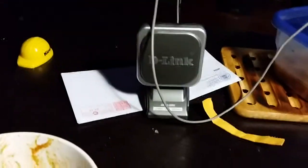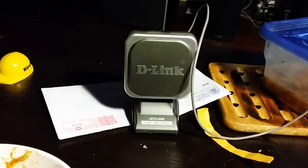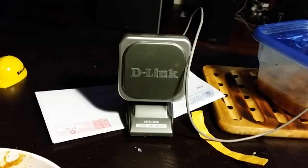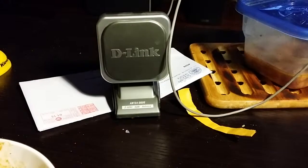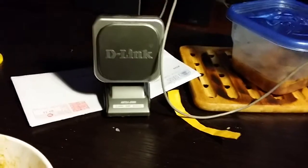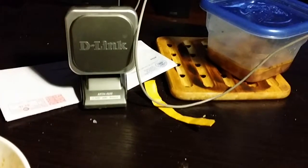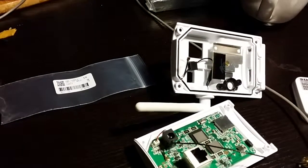What I've got here is a D-Link directional antenna — 2.4 GHz, 6 dBi. It's directional, so you can just point it towards your router; it's not going to send the signal in all directions because it's not omni-directional. Once I put this on, my signal went up to around 1.5 to 2 megabits, the image was pretty good, and the video was pretty smooth.